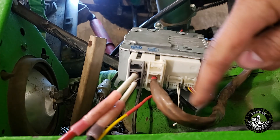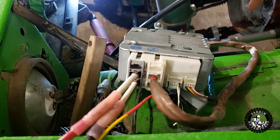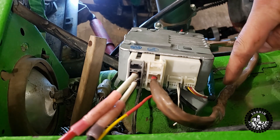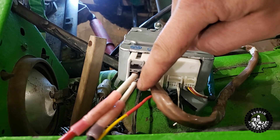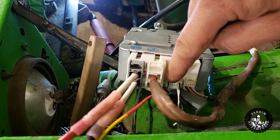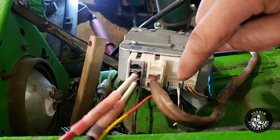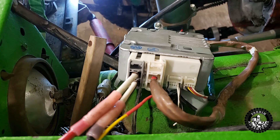I've got the wires hooked up to the ECM — the wires coming from the motor plug in right here, and the little wire from the sensor clips in here. The top wire is power, the bottom one is ground to your battery, and the very top-left little black wire is your switched power — so when you turn your ignition on, power hits that, activates the ECM, and you're live.